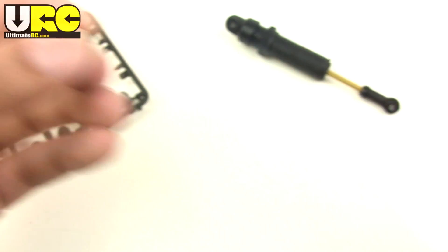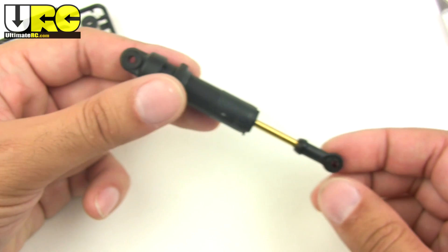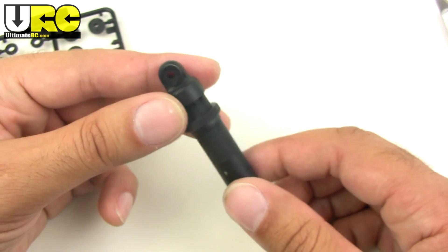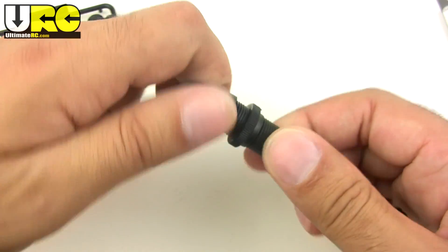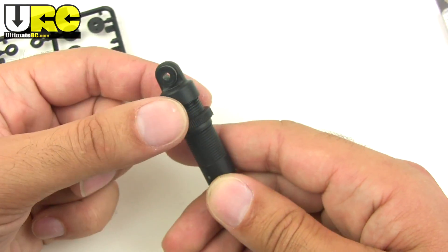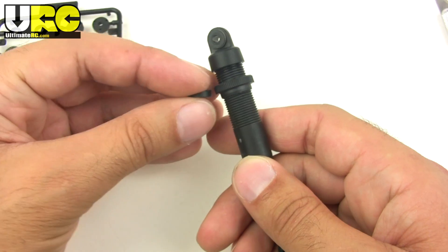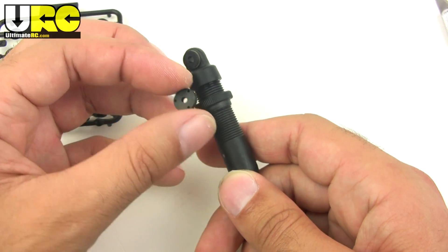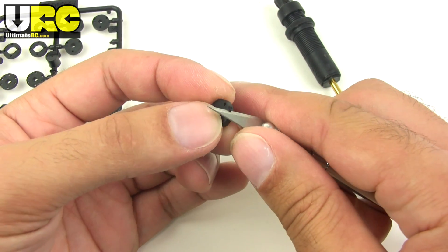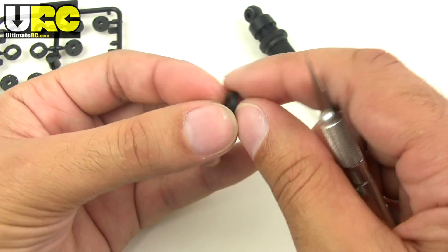So take those pistons out — it's very simple. Take the shock out of the truck; it's two screws, one of them is a bolt with a nut behind it, and the top one's just a screw. Just unscrew the cap — it screws right off — and when you open this up there will be a bladder. Take that off and you'll see a nut. Unscrew that nut and you'll be able to take out the piston right from the top; it's just captured in, no E-clips, no worries there. Pull this out, clean it off a little bit so you don't get silicone oil over everything, and then use a very sharp X-Acto knife and trim off that little bit of flashing that really shouldn't have been there in the first place.